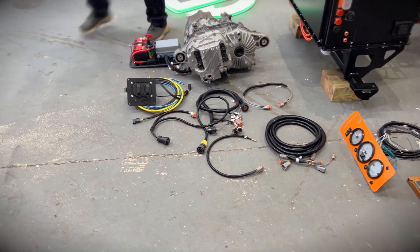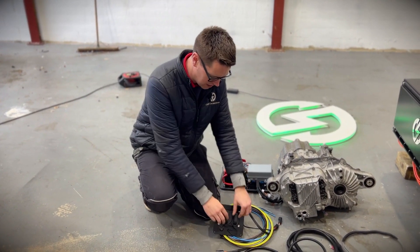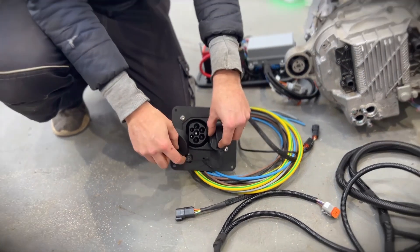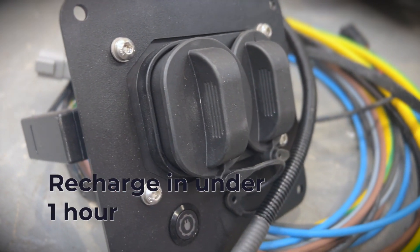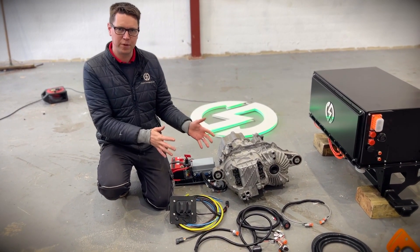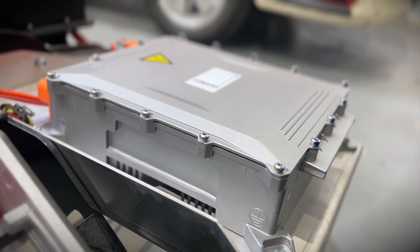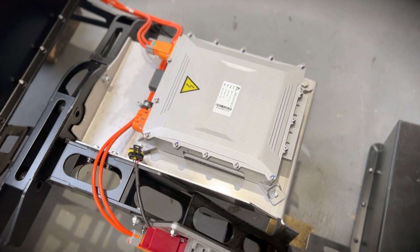This is another reason our kits stand apart from any other campervan conversion kit: CCS rapid charging. It's built into an aluminium housing that fits in the original petrol tank space, bolting onto the outside of the vehicle and covered with hatches to protect it from the elements. It's the simplest thing to plug in, enabling charging at rapid speeds of up to 70 kilowatts — meaning you can recharge your campervan in less than an hour. CCS stands for combined charging system because it handles both DC rapid charging and AC home or destination charging. The onboard charger is mounted on the subframe as part of the fabrication system, handling AC charging and recharging this campervan in around four to five hours, or larger vans in around eight to nine hours at 7 kilowatts.